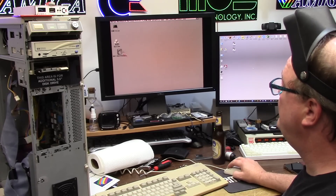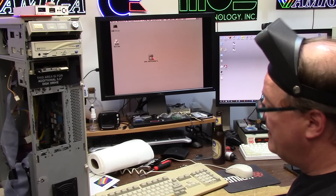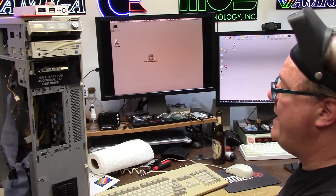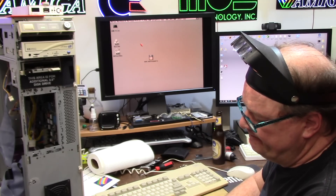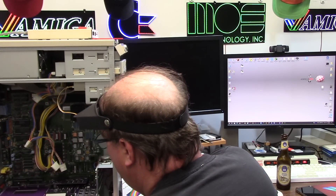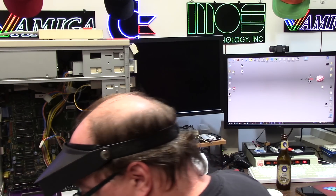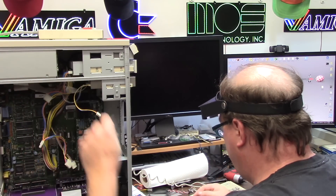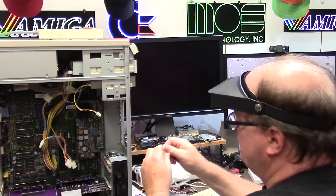DH1 is still unreadable. That just sucks — it doesn't support large hard drives. So on the 4091 is my ROM — I'm going to pull out the factory 4091 ROM and put in the open source ROM that came with it.